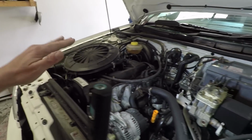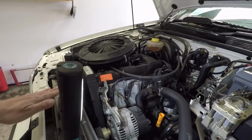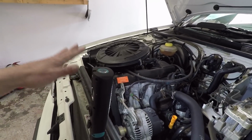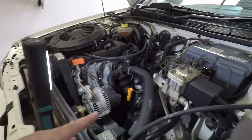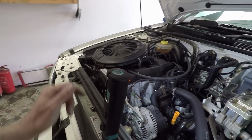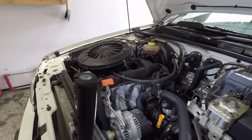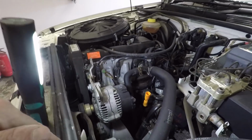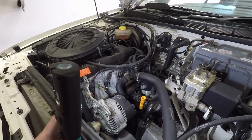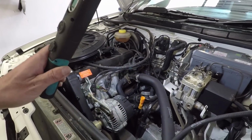Which reminds me, we've also got to get the car up to temperature. So I ran this up to temperature at idle, made sure the fan kicked in. That's a sign that it's up to temperature, ready to drain. It's always a good test of a fan as well, because on older cars, you never know when it's packed up. Well, you might find out when it's a bit late and you're on the road. So it's always a good idea coming out of winter into spring, summer to check that your fan actually works. Okay, we're good to go then. So that's it. I'll just lift it up in the air now.